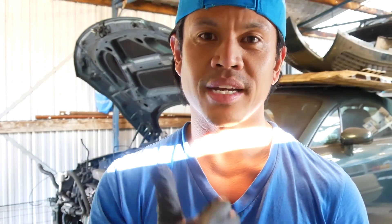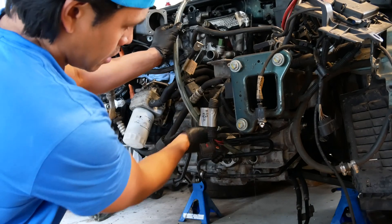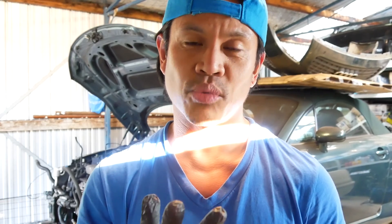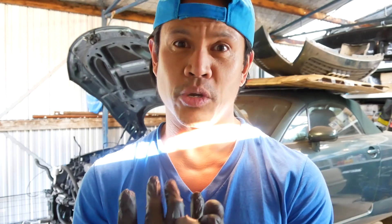Now it's an exciting point — the engine is back in. It's time to put some fluids back into everything. I've already put some engine oil in there and spun the engine around a few times to get that oil pumping. Now I want to do the transmission fluid plus the bevel box, as well as get the brakes back, so I'll probably need to do a VCDS brake bleed procedure as well as get that clutch pedal feel back.